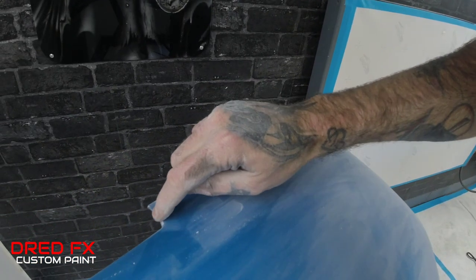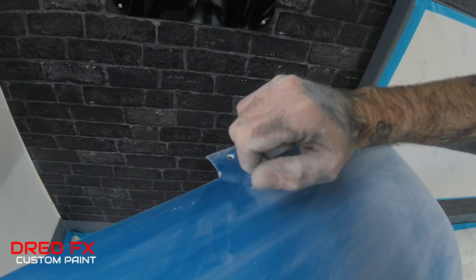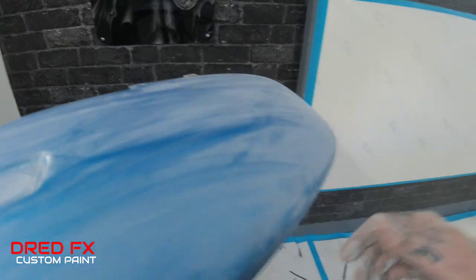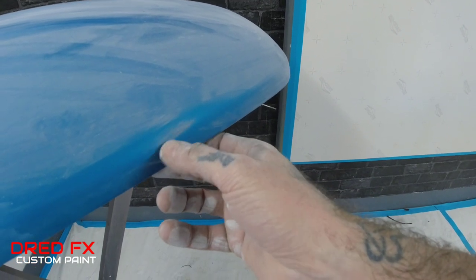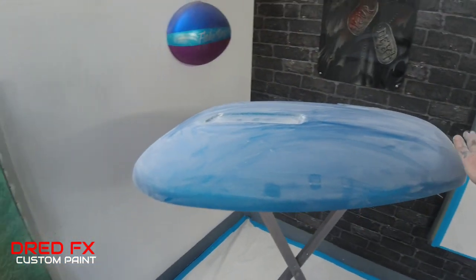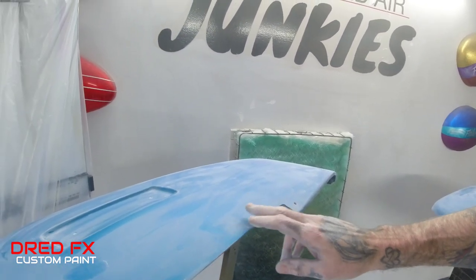I didn't want to go masking off the rubber seal — it would have looked atrocious just trying to mask off a rubber seal when for the sake of a cheap little rubber seal you can just pull it off, sand it all back and paint to a fresh surface, then put the rubber seal back to a nice clean fresh surface. It just looks better. So 320 all over. We've got a little bit in here where there's a little dink, a little imperfection — going to clean that out, a little bit of dolphin glaze over that. And we've got a little pinhole here down into the fibreglass — going to clean this up and skim a bit of dolphin glaze over that.